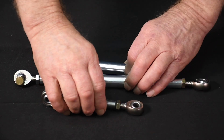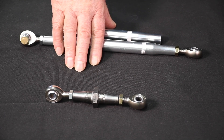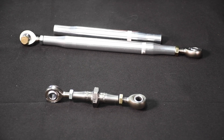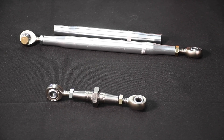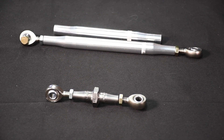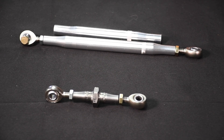The other option is to fabricate your linkage yourself from chromoly tubing. I prefer this for the short link that runs from the clutch fork to the z-bar. I cut a piece of 5/8 inch, 58-thou wall chromoly tubing to size — I simply used a hacksaw to make the cut. If you place a hose clamp over the cut area, you can use it as a guide to keep the cut straight. Then I use a fine-toothed round file to deburr the ID of the tubing. I also sand down the OD and lightly chamfer the end to allow for welding. A set of welding spuds or tubing adapters are pressed into place — one side has left-hand threads and the other has right-hand threads. Finally, I lightly grind the ID of a 5/8 inch jam nut so it fits over the OD of the center of the tube. Once welded, this allows me to use a 1-inch open-end wrench to adjust the clutch under the car.